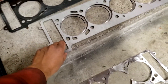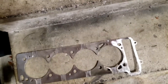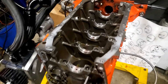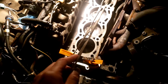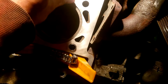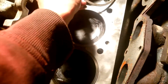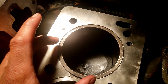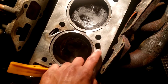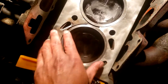This was the actual gasket that was in the race car. I cleaned it up — it's not the most beautiful surface finish on the bottom, which is why I wanted to change it out to this new plate. So what I'm going to do is use that plate and these fire rings in my daily driver, and now it'll have a fire-ringed head gasket. For the race car it's getting a nice new plate, and I'm actually going to machine some new fire rings for it because I need them to be a little bit thicker. Vented side down, pop it over the dowels, and the fire rings sit right in here — just like a normal fire ring head gasket, except I have to put a small drop of glue just to hold them in place until the head goes on. Then sealant goes around all the coolant jackets, all the way down even the ones that are covered, and sealant on the top side, and then we are sealed up.